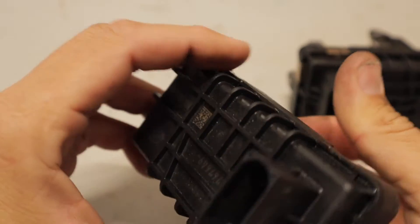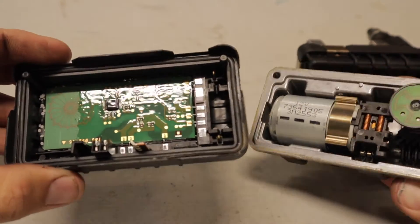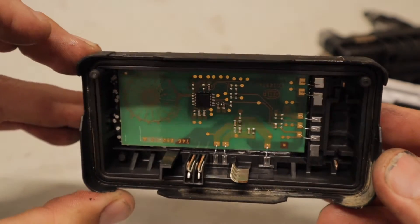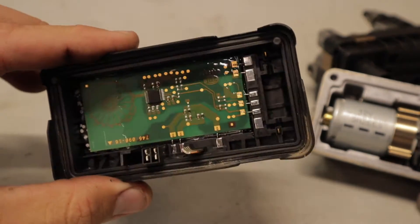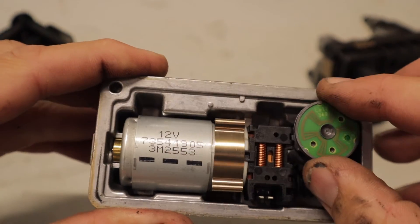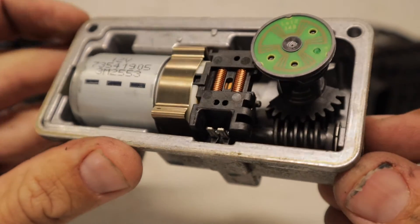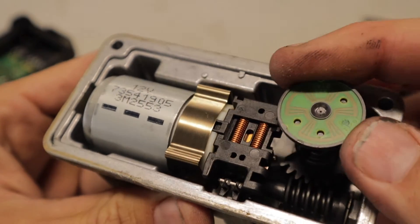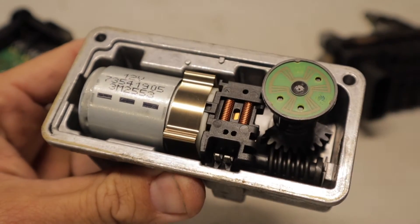Alright, so we seem to have all the clips off from the genuine Garrett one. Now it's time to open it up. First up we'll look at the circuit board here — nothing really too much to see, it all looks like it should. In here we've got the actual motor itself, and in there we've got the cogs and gears. These are what normally fail in actuators — they wear out, and this cog here is no longer being able to turn by that worm gear there, and essentially it just fails.